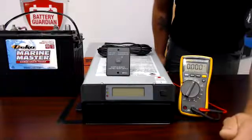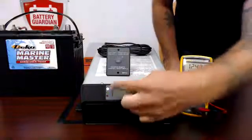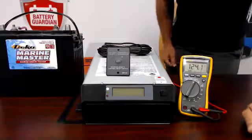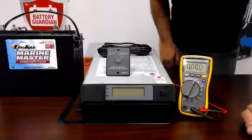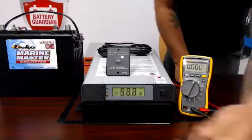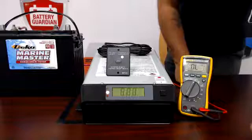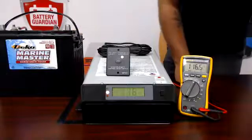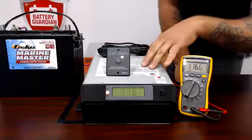When you're plugged into shore power you're going to have a green indicator, meaning you're passing through the voltage that you're plugged into at your campsite. Now if we cut off shore power and turn the inverter on, we're going to get a yellow status LED. That means you're taking your 12 volt battery power and inverting it to 120 volt AC to your appliances that are wired up to your inverter.